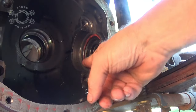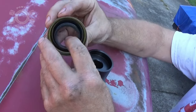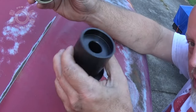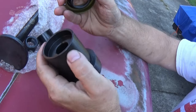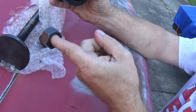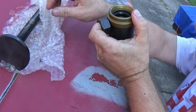The seal for the CAD central axle disconnect is right inside the axle tube, and the tool won't work for that. What you do is get a big washer sized for that seal, put it on the inside of the seal, then get a piece of all-thread from the hardware store — run a nut on one end, push it all the way through the axle, put your bigger washer on the other side, then tighten that nut to pull the all-thread and press the seal in place. A lot of you want to see me replace these seals, and I totally understand. But I ain't going to fix what ain't broke.